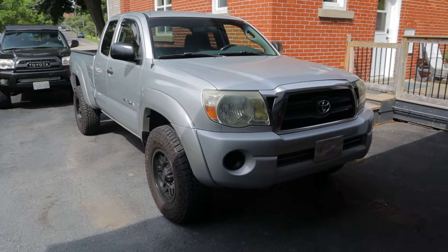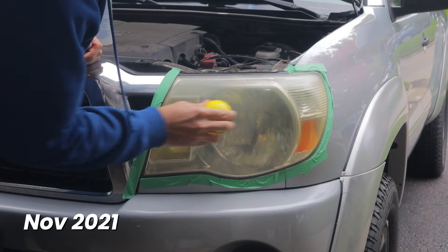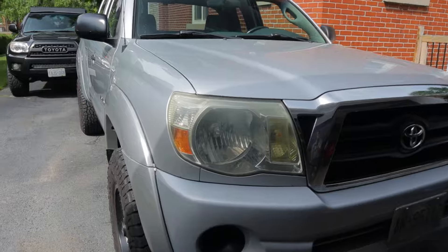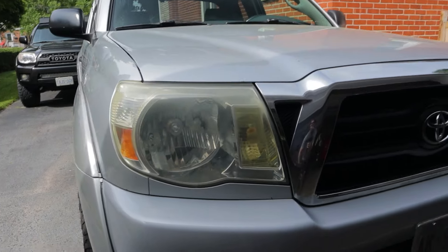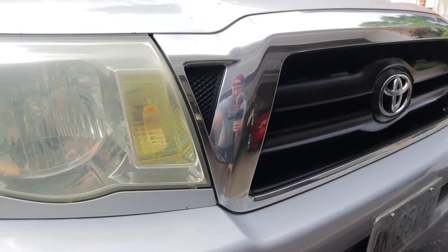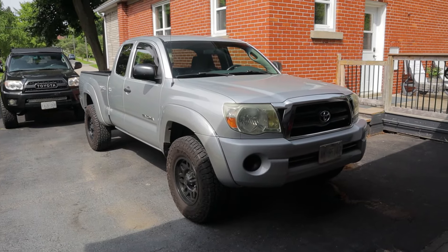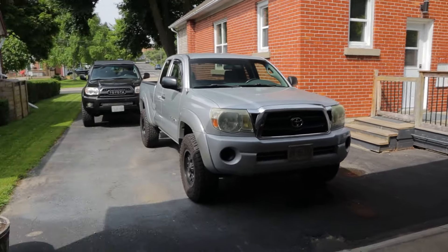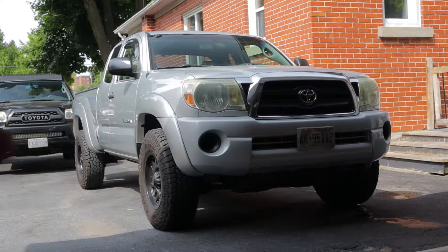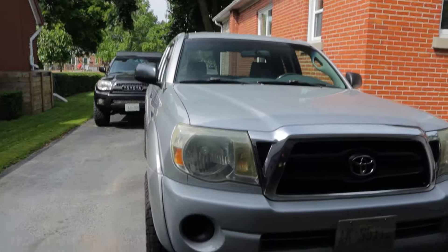Unfortunately, this Tacoma is one of those cases. I've actually restored these headlights on this truck twice now, and as you can see, it's not quite like getting a brand new headlight. They're faded and yellowed on the inside of the lens — especially this part right here. You see so many Tacomas with a little yellow block there, and they didn't come like that from the factory. That's the heat from the halogen bulb actually melting the plastic on the inside. The headlights on this old girl are just too far gone, and one of the best ways to clean up the look of an older truck is to have nice, crystal clear headlights.